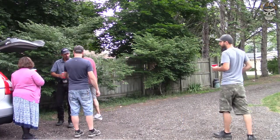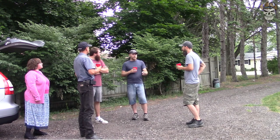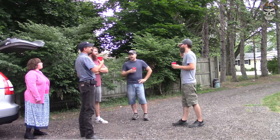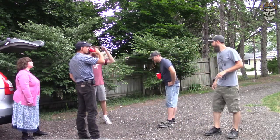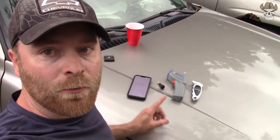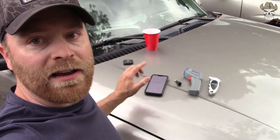Make sure your hands aren't greasy from the pizza — I don't want slipping off the pump. We're going to do one minute, two minutes, three, four, five minutes, and after that we'll see. We'll deflate the tire, check the temperature at ambient air temperature, then every minute check temperature and pressure up to five minutes. After that we'll discuss whether to keep going every minute or power through to 35 PSI.